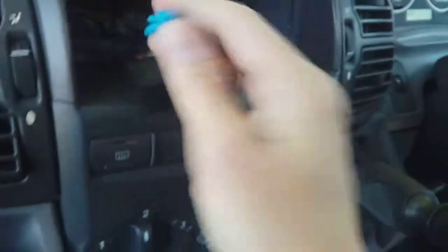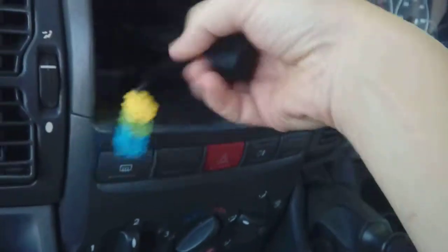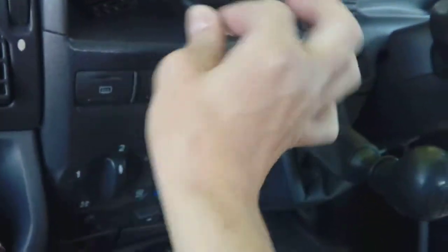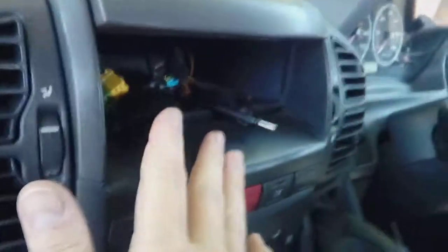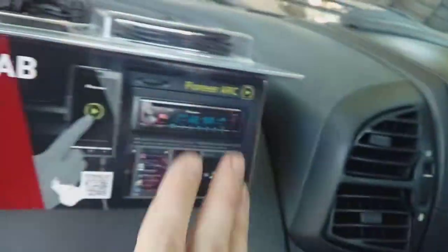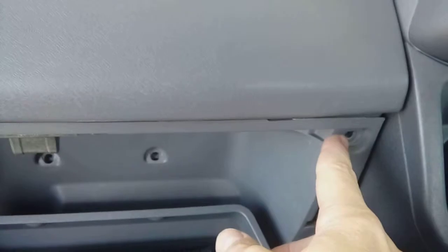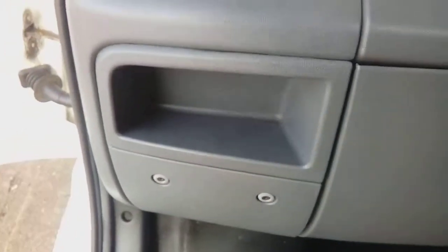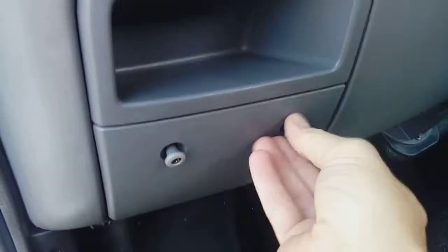Connector-wise, we won't be bothering with this one — it's simply not needed on this installation, so we'll tuck that out of the way. These are the two we're going to be needing, and obviously your aerial will need both of those. Before we do that, we need to make some room and access to run the cable to the DAB antenna, and that's where we start moving along the dash and removing sections. Start by opening your glove box — on this particular model of campervan you have TX25 screws. Remove this one, this one, this one, and then this one. Then move across to this area — Phillips head screws, just twist them half a turn, panel drops down.